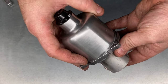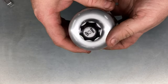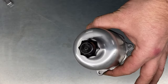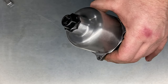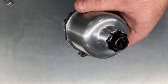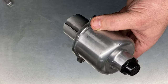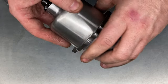Now taking the dashpot — these look pretty similar and to be fair they are pretty similar, but they do vary in the type of oil that you need to actually make these carburettors work properly. These carburettors do not all take the same oil, so in order to make these work properly for your application it will need tuning. That means someone who knows how to set these up and choose the correct oil and the correct spring and needle for them will need to do this. It's not just a case of looking in a book for the appropriate spring, needle and oil combination — they need to be done while they're on the engine to get any kind of sensible drivability from them.